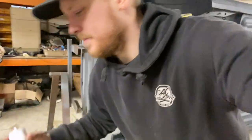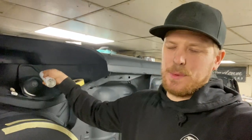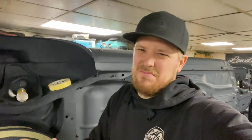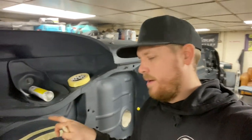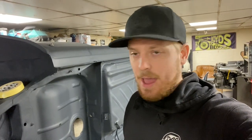We then apply the seam sealer, which I've opted for Stark MPU Sealer, which I've spoken to a few people about and it's pretty decent. We're going to get that down, sat on a wheel in front of the heater so we can heat it up because it's quite a thick, mastic material. We'll warm it up, soften it down, then use a silicone applicator gun to apply it on to the car and then go over it with a brush to brush it nice and flat. With the tape it will give us a nice straight edge wherever we don't want the sealant to be.